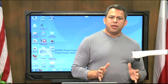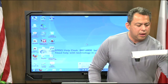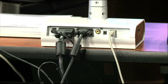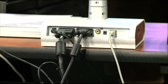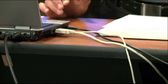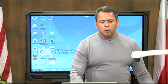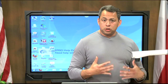At this point you can switch between the two, but the ELMO and the smart board still are not talking to each other. In order to get those two pieces to talk to each other, we have to connect a USB cable. On the ELMO I have the USB cable right there, and I have a USB cable on my laptop. I just choose any of the USB ports available. Now I have it connected, and I also have my smart board connected to my laptop on both pieces. Once I have those two setups completed, I can go ahead and actually use them in conjunction.